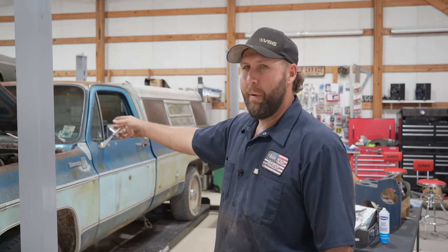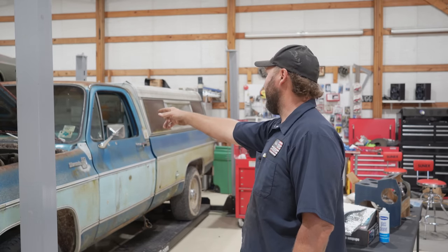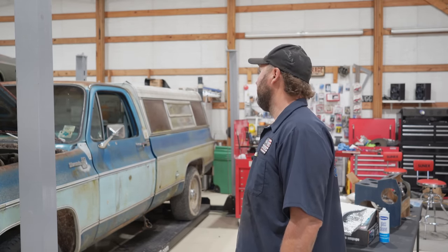So far the electrical system on the truck seems to be in excellent condition — pretty much everything is working, with the exception of the power locks, which is probably just a switch. Nothing on the passenger side either. Next, does the key do the key thing to the starter? Does the starter turn the engine over? Before I do that, I'm going to disconnect the fuel line from the tank — I don't know what's in that tank. The gauge is saying a quarter tank of fuel, but if there's still gas in this that's that old, who knows. So let's not pump it in right now.